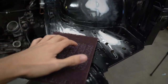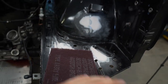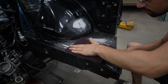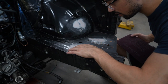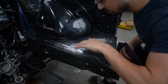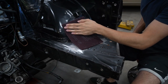I'm coming in with this red scotch pad and scuffing this whole bottom part out because I might as well just paint from here back. I might have gone a little too much over the Bondo though — damn, the Bondo was really good before and I should have just gone around it. It's so much worse now. Okay, I am definitely not touching this anymore. I should go over it again but I don't care enough to. I didn't know that was that aggressive.